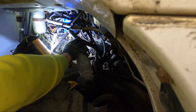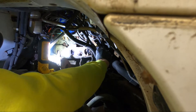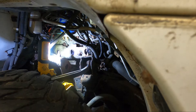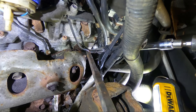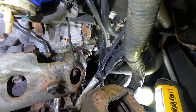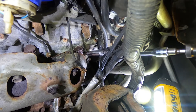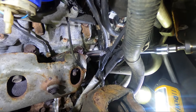First I'm going to spray it. It is an eight millimeter and that is all rusted. Got to break that free. The eyelet is turning with the rusted nut, so I'm going to impact this. Ready, steady, go — got it. Sheared the thing right off. Impact again. Put a bigger battery on, let's see if this works. There it goes. There she is.